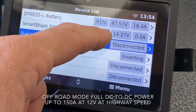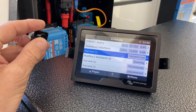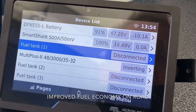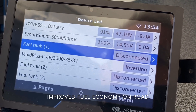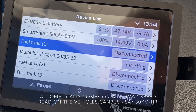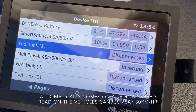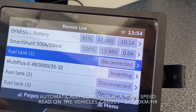It's rising — 52, 55, 55.8 — even though we're already at 91%. Now when I flick it back into on-road mode you can see 10 amps coming back into the batteries and there's no load on the engine. This on/off-road switching can be done in one of two ways: we can have a physical switch in the console for this vehicle, or we can have it automatically activate over a certain speed as read from the CAN bus.